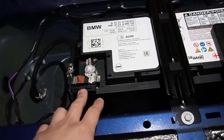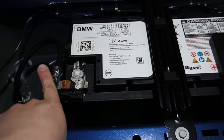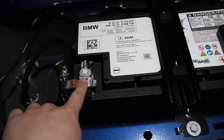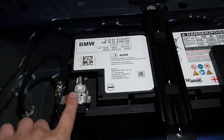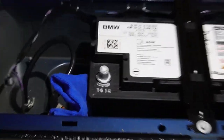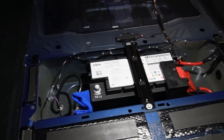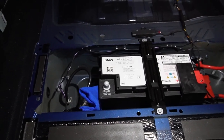After that, we're going to disconnect the battery by removing the negative terminal from the negative post. Flip it aside, and we are going to wait about 15 minutes to let the power dissipate. This ensures the DME won't receive any power while we're removing it. I've also wrapped a towel over the cable as an added safety measure so it doesn't accidentally touch the negative post.